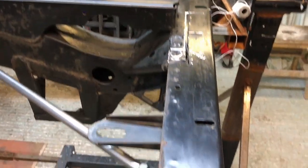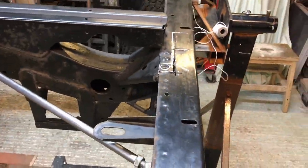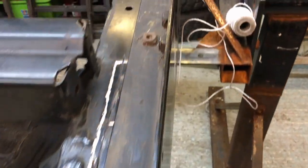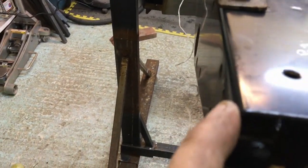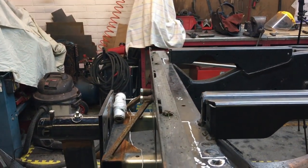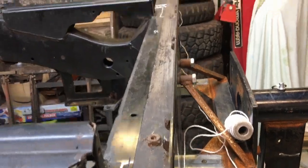Basically now we've got the straight crossmember rather than the bowed-in one. That one's bowed in, this one's straight. And now once again we're back with the body mounting bracket on — you can see here lovely and flush, and if we go all the way down you can see it's lovely and flush all the way across until we get to this end. This is the side that hasn't been done and you can see there's that huge step there — it obviously gets more and more as it comes out. The actual bend is around about here; by the time you get back it's about six to eight mil, maybe even ten — that's how much it's hanging inside the body by.